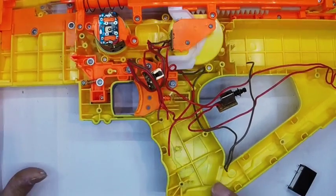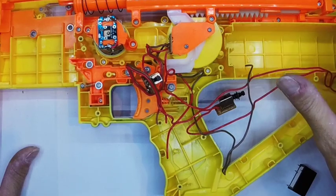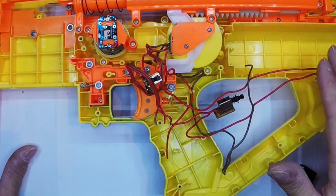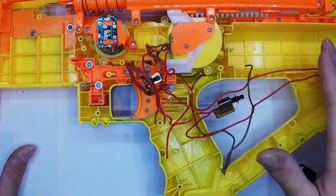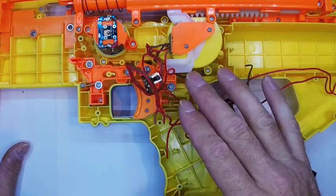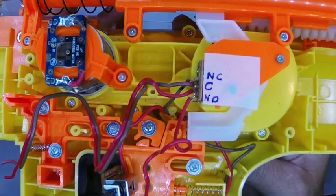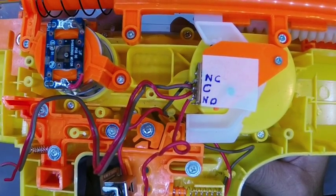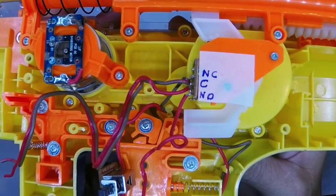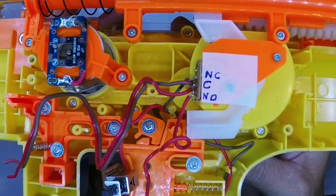We're going to start — I'm not going to cover the spring replacement or how to open up your Stampede. As in my last guide, if you don't know that, don't do this mod. It is a moderately advanced modification — not a beginner's mod — and it is a very simple loom but it looks complicated. I'll run through which wires to keep and then run through connecting it all up. There's the standard cycle control switch: the top pin is normally closed, the middle pin is the common, and the bottom pin is normally open. Those are now labeled on the wiring diagram on the BSUK site — I'll provide a link in the description box.